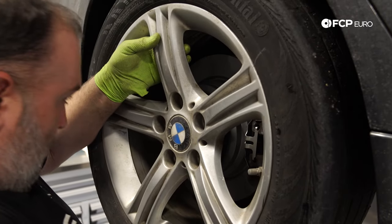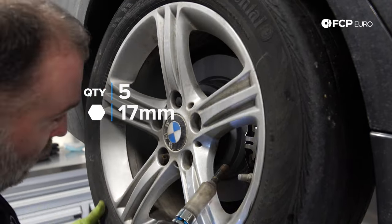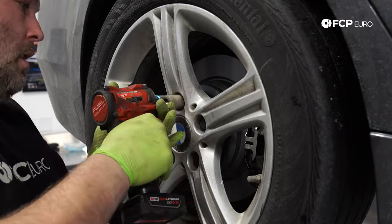It's going to be the same process on the other side — just don't have to worry about the pad wear sensor. So that's how you go about replacing the rear brakes on any F30 that has the standard style floating rear calipers. This will not apply, like we said in the beginning of the video, to any of the F30s that would have the Brembo style, whether it be the factory installed or the dealer installed performance package. I hope you learned something from this video. If you have any questions or comments, leave them in the comment box below. Hit that like button, subscribe — lots more videos on the way. We'll see you for the next one. Thank you for watching.